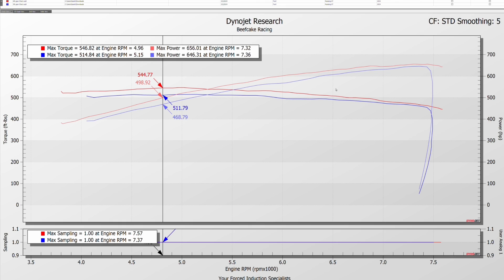This pull here had a peak of 646 horsepower and was a fifth-gear dyno. Any dyno run should be done in seventh gear, which is the one-to-one ratio, because when calculating true horsepower you want a one-to-one gear ratio. On an old 4R70, that's third gear. On a 6R80, it's fourth gear. On this 10-speed — the 10R80 — seventh gear is one-to-one.